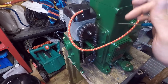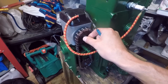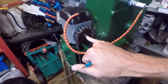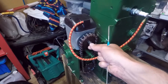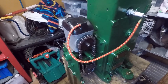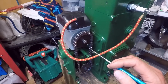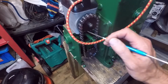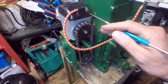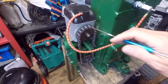As you can see here, there is a repair I had to do because some of the back of the shaft had snapped off. I basically drilled the hole and now the nut is secured by this. The sprockets have been treated using chemical blacking so they're not going to rust away.